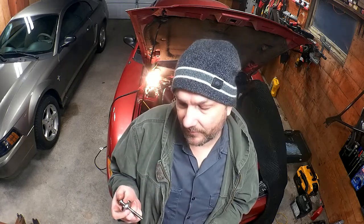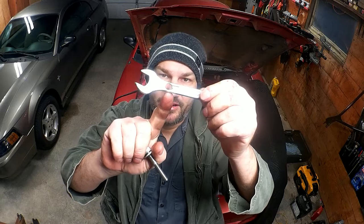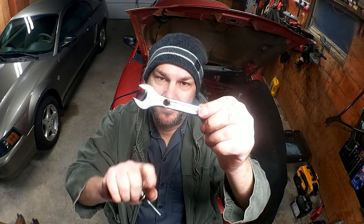And lesson learned, I think if I used a 3/4 inch instead of a 5/8 inch as my sacrifice, there'd be a lot more meat in this area here, because I'm really asking an awful lot of that little bit of metal there. And so that's making it bend a little bit under use. And when it lets go, there's a lot of energy there. I've been wearing goggles because I don't want to lose my eyes, but I could also be in pain. So the pain part is crappy, and I could also lose the little keepers, which might be even worse than being in pain, because those are parts I need for the car to go together. So, lesson learned on this.